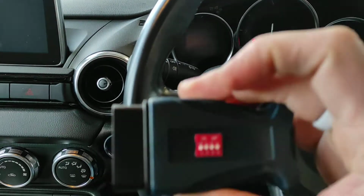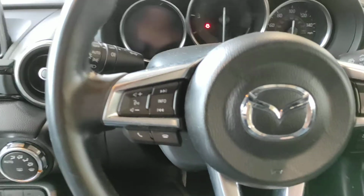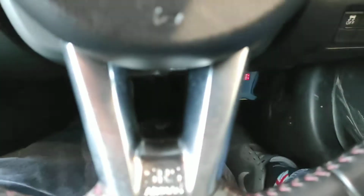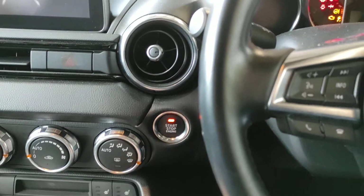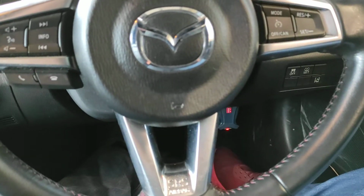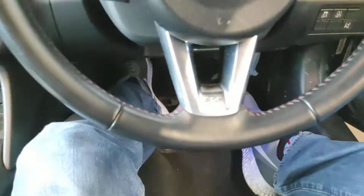We can get the dash back on again, so we go back to check key mode. We plug the unit in and we wait for the purple indicator before we press the ignition twice. There we go. And that gets us the dash on. Again, no keys programmed. So what we'll do is, we'll add these 2 keys in now, grab them back here.